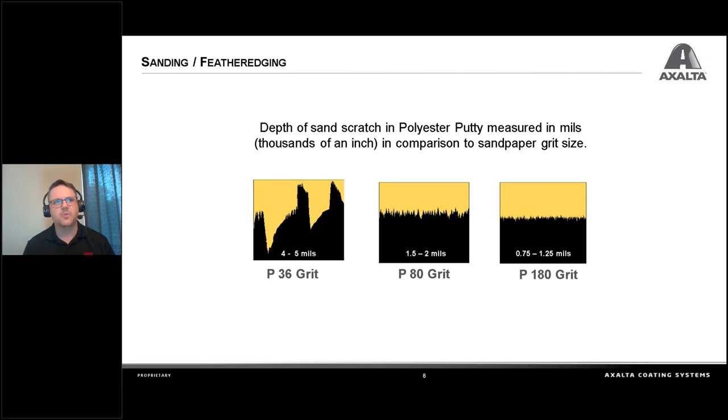If we think about it — picking one product as an example — we're going to spray maybe six mils wet. If that primer has a solid content of 47%, that means 53% of those six mils is actually going to evaporate during the drying process. So I'm left with about three mils out of six. If I've got a two-mil scratch depth, I'm left with maybe a mil over top of my primer. That's really what people don't think about. Reading the technical data sheets is very, very important because it actually spells all that out. Whatever paint system you're using, go to their website and download their technical data sheets — I highly recommend reading them.